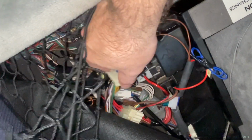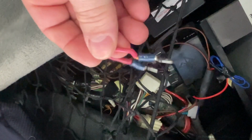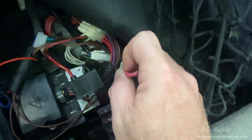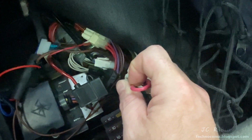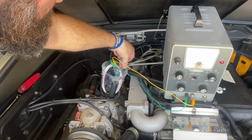So what I'm going to do is pull my RPM relay and plug in this bypass wire I keep in the ashtray to pressurize my fuel system. So I'll leave this in, and I can hear the fuel pump go for a bit, and then I'll unplug it, and then I'll disconnect the battery, reducing my chance of any unwanted sparks. This time I'll be running off of the switch of the power supply, which has a spark arrestor inside.